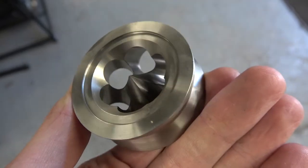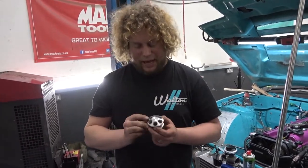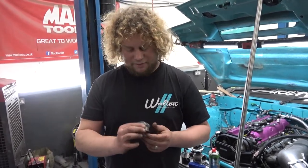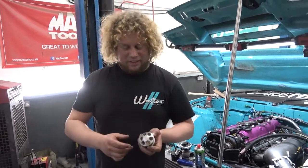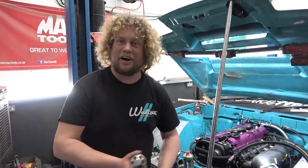This flange was completely drawn in-house and we outsourced the manufacturing — we don't have the machinery to make that unfortunately yet. TurboSmart's design uses 19mm pipe to go to each of the runners, but because this is a six-into-one, we found we didn't have room to fit six around there and make it look nice and work well. So we've gone for a slightly smaller size — a neck size down — which is 16mm. We've used that neck size down pipe on goodness knows how many exhaust manifolds in the past with similar systems, so we're fairly confident this is going to work absolutely fine.